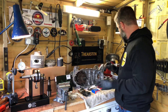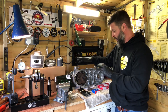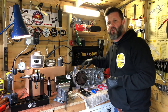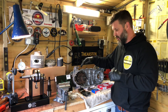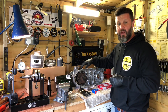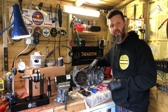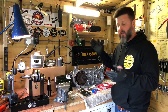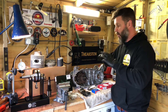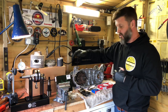I don't know exactly what horsepower that'll kick out — he's not particularly interested, and in this build neither am I. The factory figure was around 12 horsepower for a standard 200cc engine at the crank. At the back wheel when I measured them on my dyno they were around about nine horsepower. I would expect this with a clubman pipe on to be something in the region of 14 to 16 horsepower, which isn't crazy in today's world, but it'll give him the SX200 gearbox, nice gearing, and a really nice steady ride to enjoy.